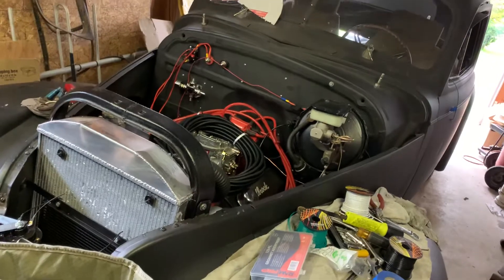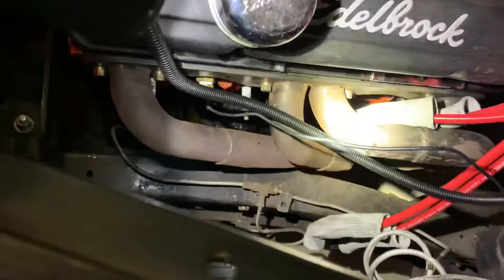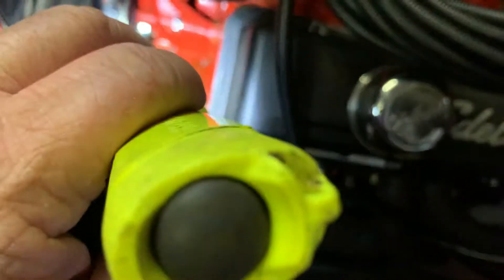I'm watching YouTube videos and not finding a whole lot of help. Even if I have to take the header off and the starter off — I don't know if I can drop the oil pan on this car or not. Looking from this side, I don't know if that cross member is going to be in the way. Looks like not — the cross member is there, the next one is at the tranny. So I can probably drop the oil pan and maybe pull it in from underneath or push it up from in there and put the oil pan back on.